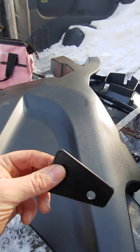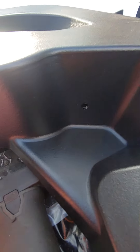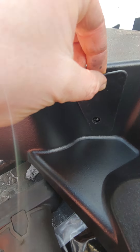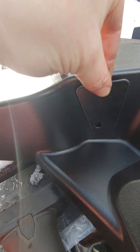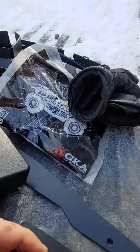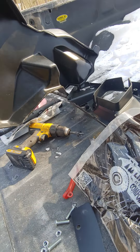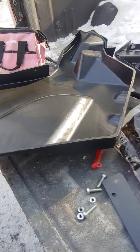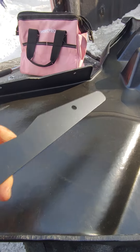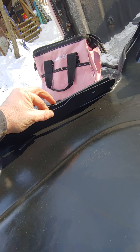I'm going to show you where these outer door reinforcements actually go. The door has holes already pre-drilled — there's one there. That's how they mount, right in like that, and that's to give the door support with the hardware, pulling it all into shape. The same goes for the larger bracket here — you can see the shapes cut out and how it fits underneath.